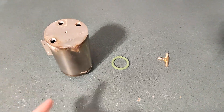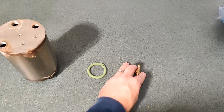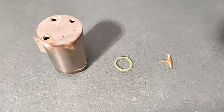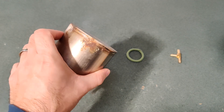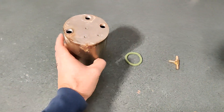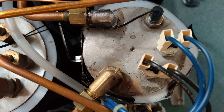I had to replace a few parts associated with that — one was the gasket. Upon further inspection I had to replace something else, which I'll cover in a minute. What happened with my brew boiler was a defective weld. You can see on the sides there's a lot of rust; water was leaking through the welds and coming out of the boiler, completely disintegrating the insulation on that side. There's a picture above the brew boiler with the machine open showing what happened to the insulation.